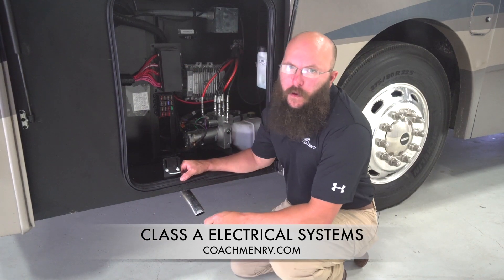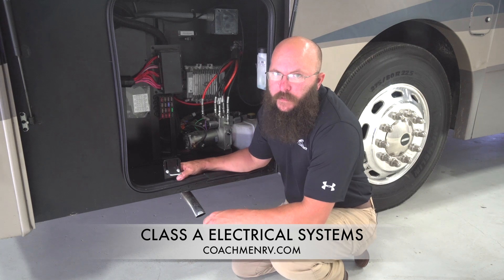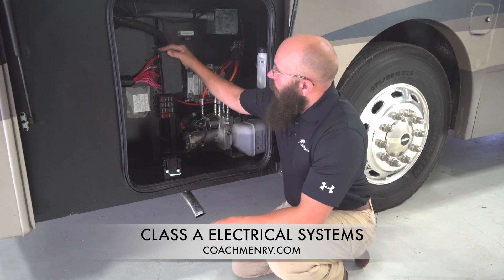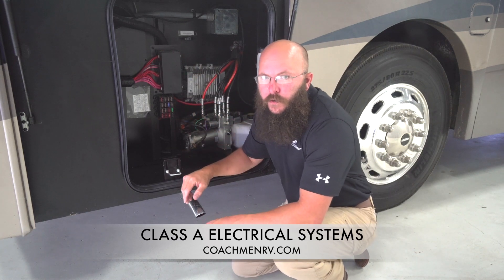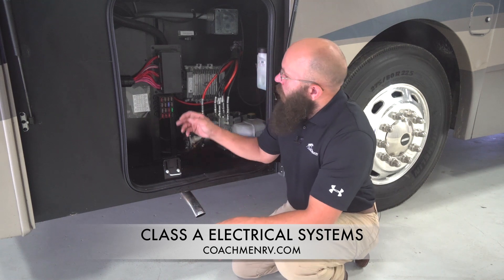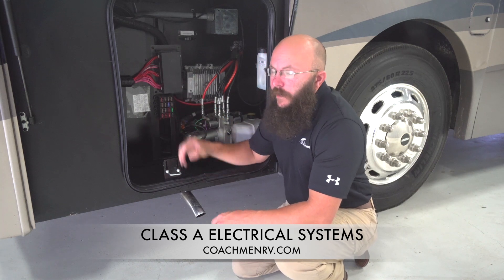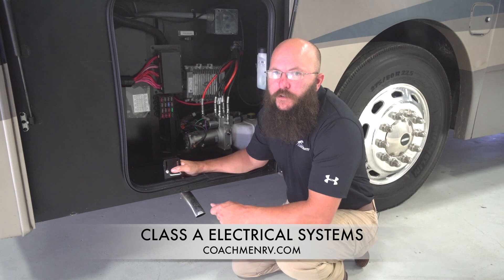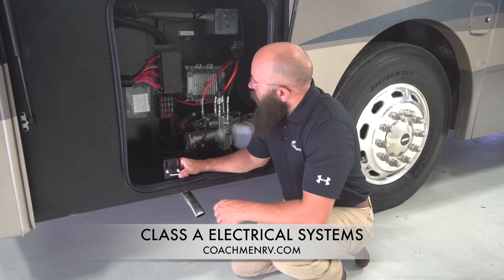We're on another corner of the motorhome right now — the front driver's side, right underneath the driver's seat. On a Ford, this same kind of thing is on the inside, firewall-mounted at your feet. This is just another distribution panel fuse box for the chassis itself. The one you see right below this is more of an R-block — this is where we tie our dash harness into. Any functions related to the drivability of the motorhome are here. Some of these are ignition-defeated and ignition-powered. This is really our integration into the Freightliner or Ford fuse box, and we label ours right beside it so you've got quick access.